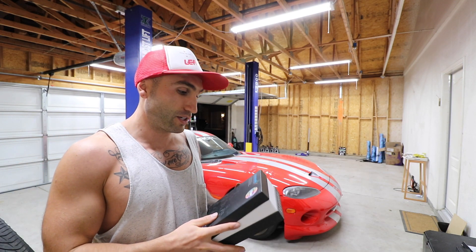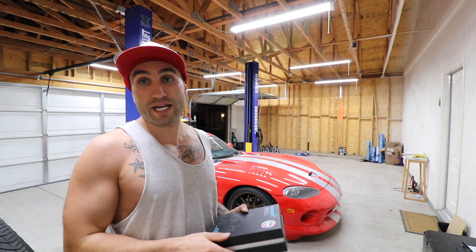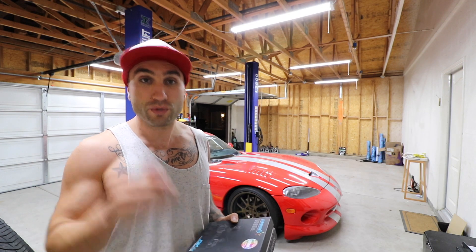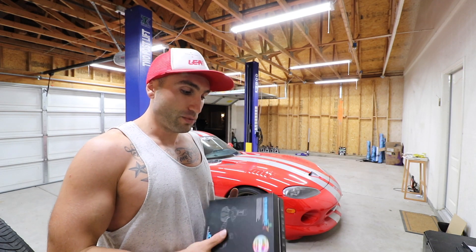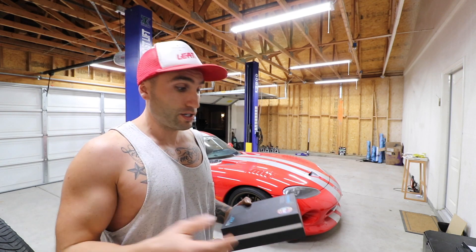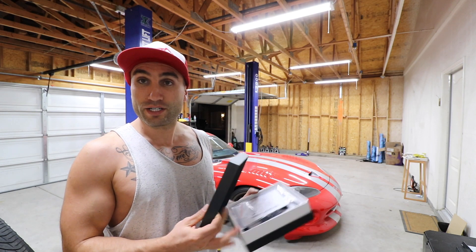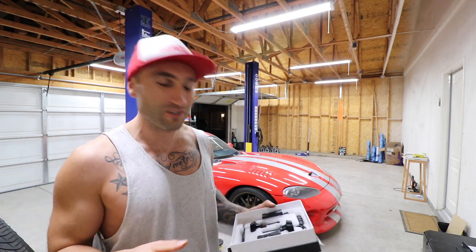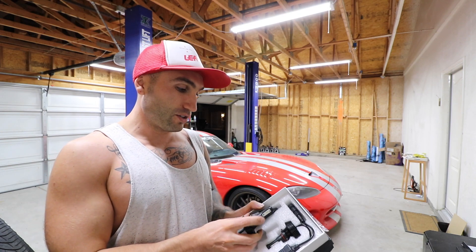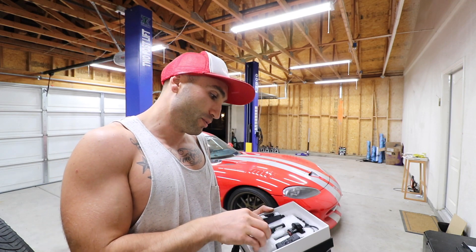You need the decoders and all that stuff in conjunction with them — even though the fog lights on these trucks won't throw a light on your dash, you will still get some flickering with the Hikaris unless you have the decoder, because there's not enough load on the system. So the Hikaris end up being quite expensive by the time you're all said and done, and they failed. I'm gonna try out the JDM Astar in another video and stack them up against the tried-and-true C6s, which are like 20 bucks. I'll put them to the test and see how they stack up.